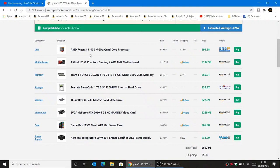And you've got much more chance from working on a B550 or an X570 than you have anything else in the product stack. So you are giving yourself a little bit of future proofing. You've got PCIe 4, obviously, across some of the lanes, less so than in the X570, but certainly for most people, for maybe an NVMe drive and a graphics card, that is what most people are going to be concentrating on. So you are having some future proofing.